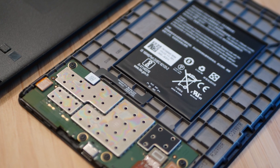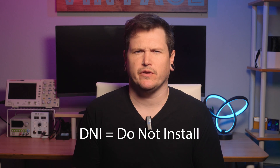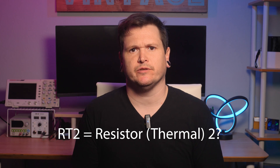The battery connects to the device's mainboard through a flex cable with a tiny connector. That connector supports 6 connections — 4 more than we would need for just positive and negative. So what are those 4 connections? They were helpfully labeled on the cable: DNI, RT2, NC, and ID. After a bunch of research and experimentation, I was able to identify the function of 3 out of those 4. DNI stands for Do Not Install. Earlier versions of the Kindle Paperwhite had an additional thermistor connected to that pin. RT2 stands for Resistor Thermal 2, or something like that — this is the connection to the thermistor on the battery pack that tells the Kindle if it gets too hot.